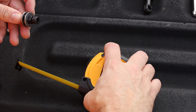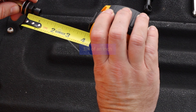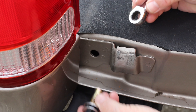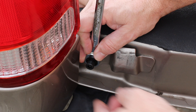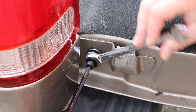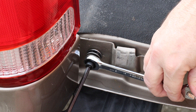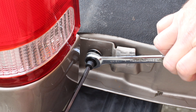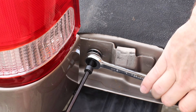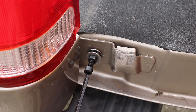...this is three-quarters of an inch away from here, so just adjust it out to get it set. All right, so this is on the driver's side. The nutsert is going to be inserted into this hole. Then you're going to take your 13 millimeter wrench and your 6 millimeter — you're gonna hold this steady, you don't want to turn it — and then this is going to be turned clockwise until it gets a little bit tight. Once it starts... there we go. After you're sure that's tight — and there are two ways to do it: I counted every quarter turn, or you can make a mark here and count the number of times that mark comes around.